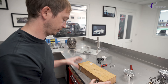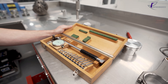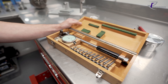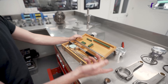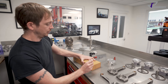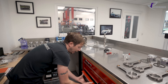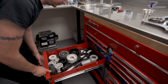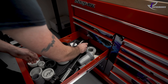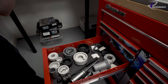I got given this when I was on placement in Germany — a ball measuring tool. That's what you use to measure your bore diameter or your bearing. It'll do your big-end bearings, your main bearings, and your bore. I haven't quite saved up the pennies yet to buy the Sunnen one. Just 20 years of accumulation. Another valve stem seal tool remover, and the new Daza engine cam locks — they have to put in front and rear main seals.